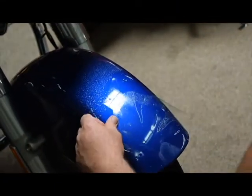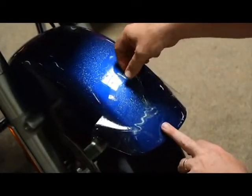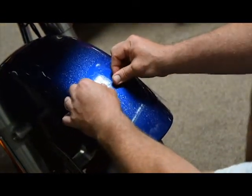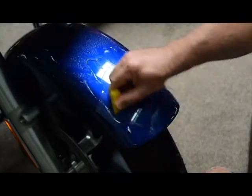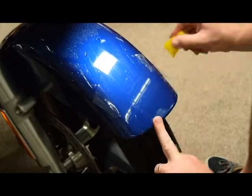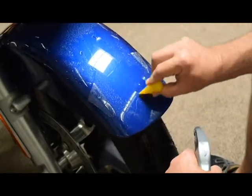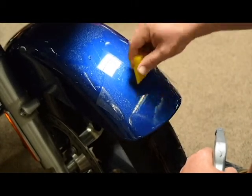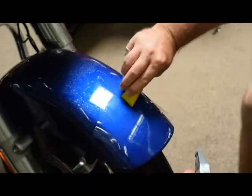Now at this point that front edge is good and anchored, so just make sure it's wet. Now what I'm going to do is basically pull this tip just up a little bit to help get some of these fingers to lay down — giving a little bit of tension up there and then squeegee it up. Use overlapping squeegees. The bottom was anchored, so you don't want to try and take bubbles through it. You want everything to go side to side or up out the top, so you don't trap any liquid or air bubbles underneath the material.